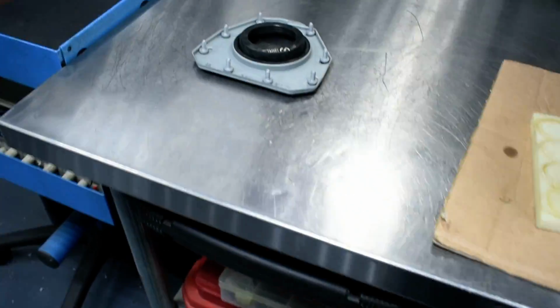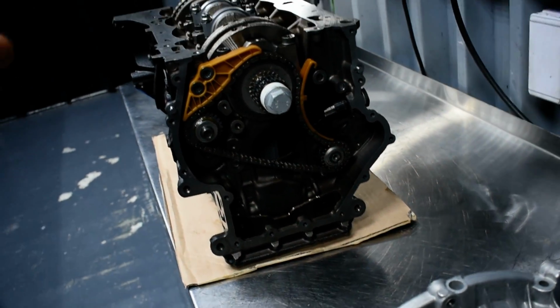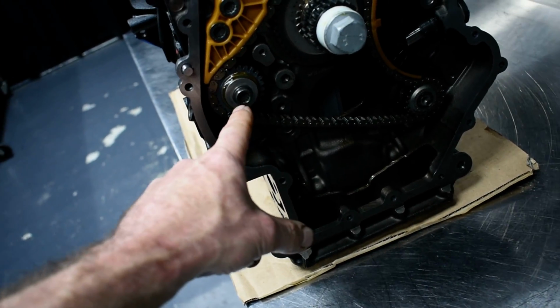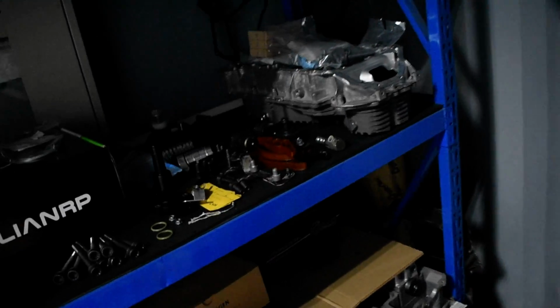Because these 2 bolts are missing and also the 5 bolts in the middle, I cannot continue closing it. Crankshaft rear seal here, standing by with the new bolts, everything there. Every time, every single time the same thing. How many times? Anyhow, so where am I now? Piece connectors, crankshaft, bolts, everything's okay, everything's torqued down. I have only the timing chain for the balance shafts, for both. It's on timing, it's torqued down, it is on timing up to now. The tensioner, obviously, has not been torqued down because this guide is missing, and that's it for the timing. This is what I have for this engine. So, again, waiting for the stupid bolts. And I have said to the driver 100 times, you know what, this and this and this, and he made a list also. That doesn't matter. He has to do it again.